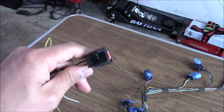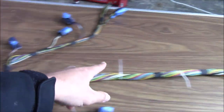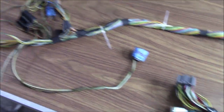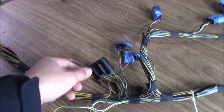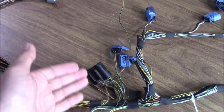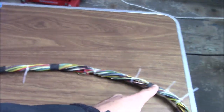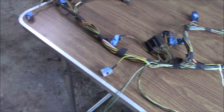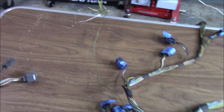I have this wire right here that I already started on — this was his EVAP connection, he's not running that anymore, so all this wire actually ran all the way to the ECU pins. I removed it from the ECU connector but I left the one ground wire on the junction so I can demonstrate how to d-pin, because the junction is so big you can actually see in good detail how you need to d-pin. This is going to move all the way to where the ECU pins are — I'm going to be cutting one wire at a time and extending it all through this harness.